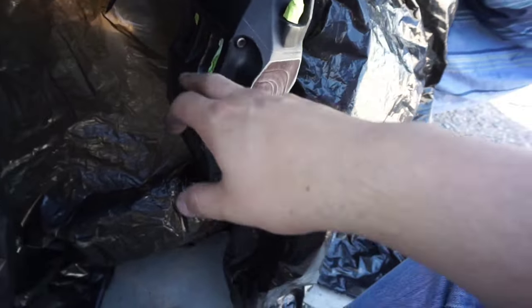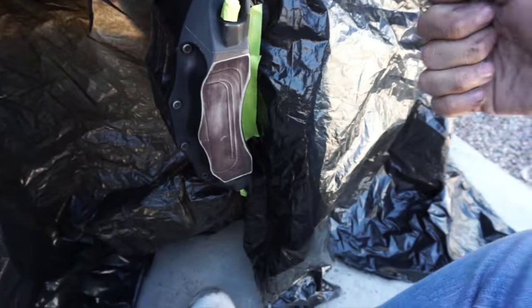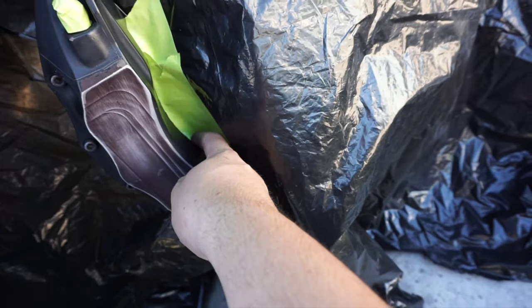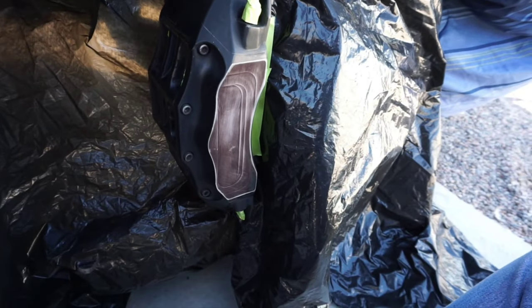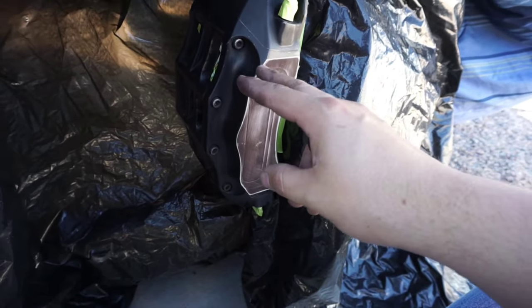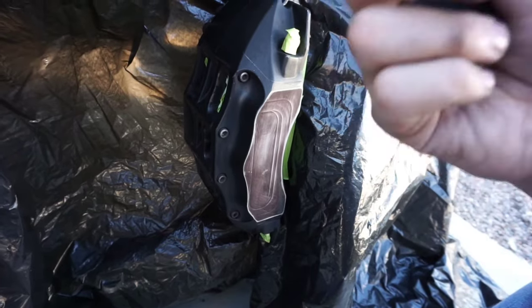All right, so as you can see, I got everything masked off. I did tuck some tape in here where the pads are, and that's what I mean by cutting the slit for the caliper half the size — when you stretch it out, it kind of contracts back in there. I taped here because you can see a little bit of the pad and the rotor, and I taped off the bottom brake line too. I'm gonna hit it with some alcohol before we do a tack coat, just to make sure it doesn't bubble up. Then give it five minutes and do more coats.